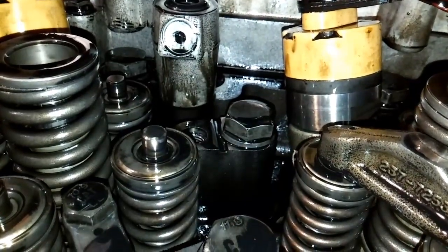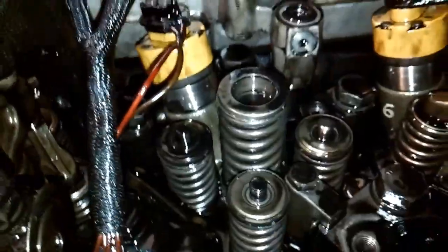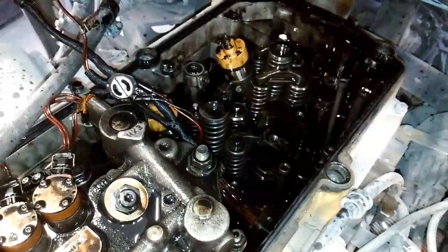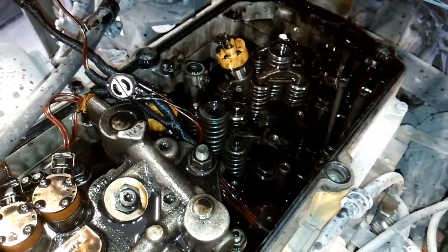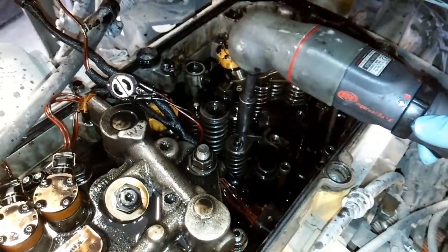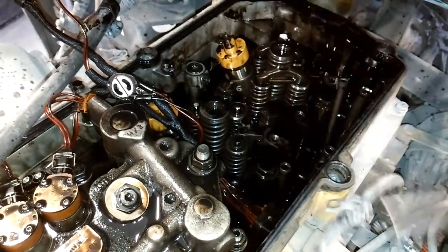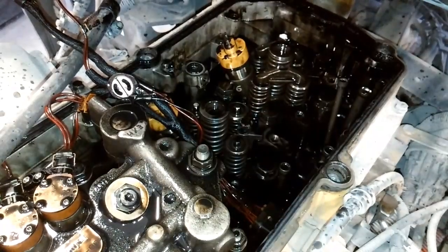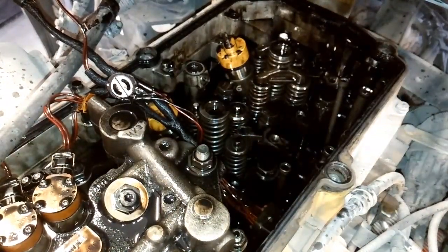You can kind of see that — I'll show you a better picture. But to do this compression check, we're going to need to remove the injector first. So the first thing you're going to do on any diesel engine is remove the injector, and that's to get to the combustion chamber. Now when you remove it, there's going to be some fuel that dumps into the cylinder, so you're going to want to spray it out with a little bit of brake clean and then evac the cylinder out. I'm just removing the hold-down bolt here, and then I'm going to pop the injector out.